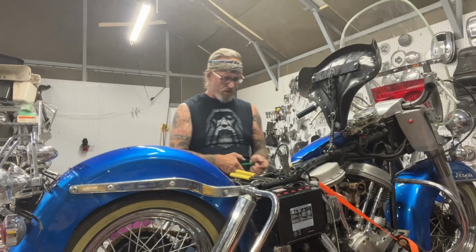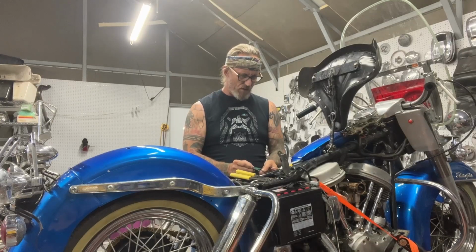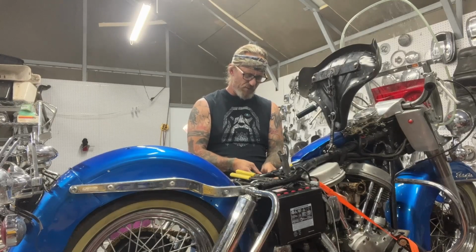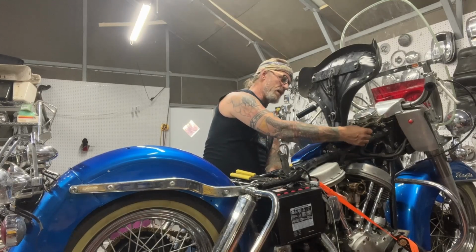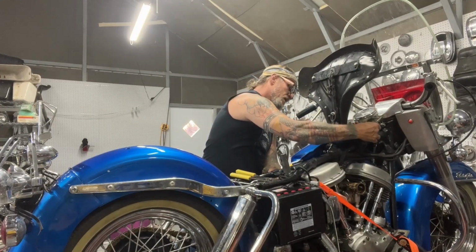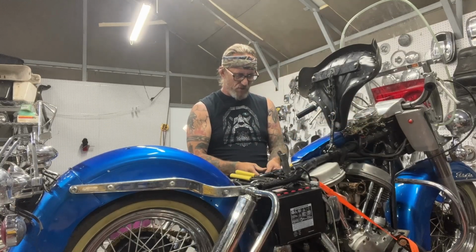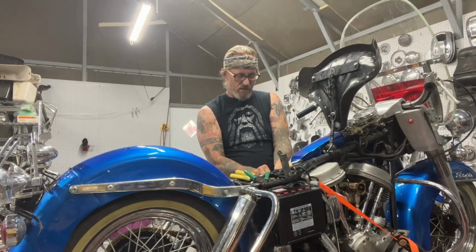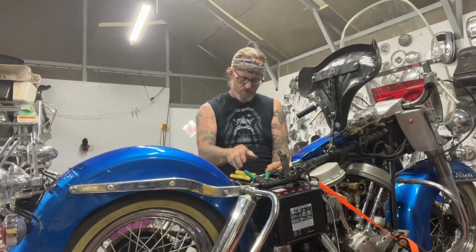And fortunately, part of the issues we've been having with some of this stuff is just miswired. The horn wasn't wired at all. The neutral safety light switch is not wired. I don't care about the neutral safety light switch, but it's there. I should have it wired in. I don't know if you can see, it's over here, just black taped off. And I haven't traced it to see. I know if I push this to the accessory side of the ignition switch, it does light up the bulb like it's supposed to. So I'm kind of wondering if it's not hooked up at the transmission, the little spring-loaded switch on the transmission. There we go. So we got that wire in there.